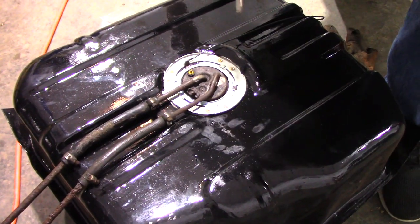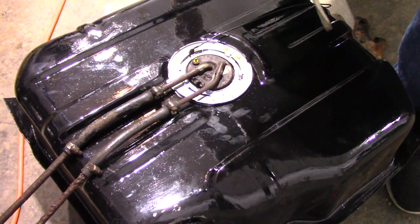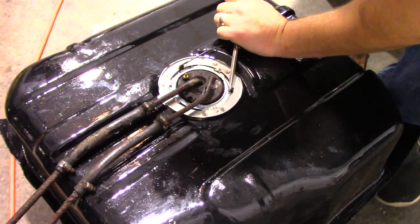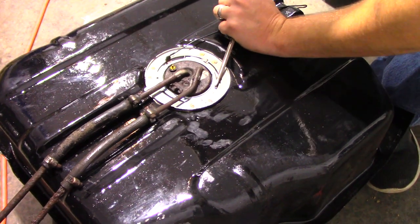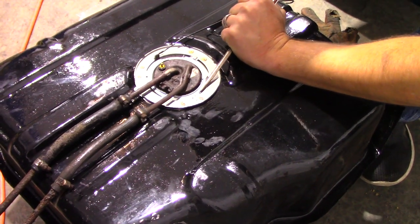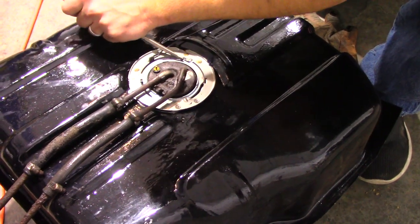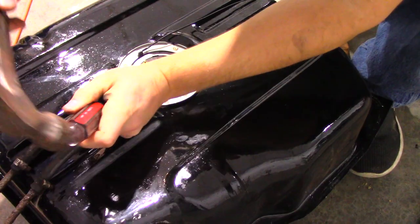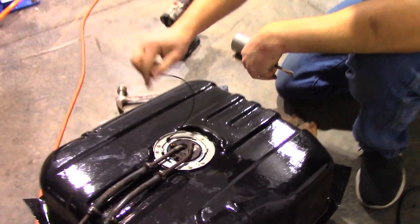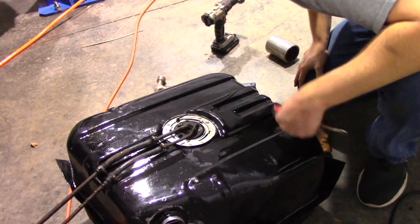So what we're doing is - there's our new lid for it, old sending unit, still in good shape. You just get ahold of one of these tabs, take a screwdriver and hammer, and just tap it all the way around through there and it seals up against that O-ring. Just like that - boom, all the way around. We're done, it's in there. Now there's our ground strap, we'll hook it up, and there's the connector for our fuel gauge. We'll be in good shape, guys.